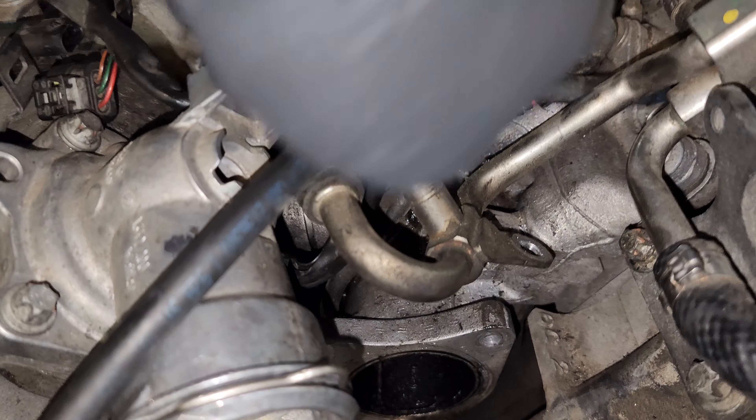Next, you want to take out this right here — this is also part of the fuel return line. Remove this little clip and this pops right out just like this. There's another O-ring on here you're going to want to replace. Once all that is done, we can start to fold the harness all the way over — it's going to come all the way over here. Then put a bungee cord around here to hold it over there. Now you have pretty much complete freedom to take out the intake manifold. I do recommend putting some rags over this harness because that thing can get quite oily, and if you don't want your arms covered in oil, just throw some rags over that. So almost ready to take all the bolts out, but you want to take out that hose attached to the EGR valve and disconnect the EGR valve.